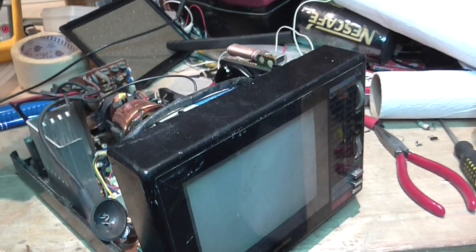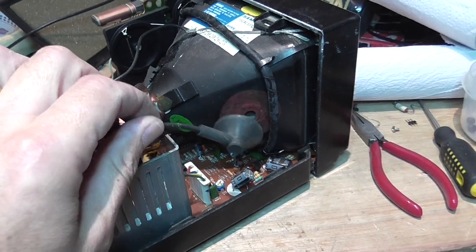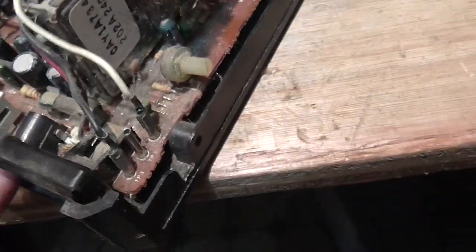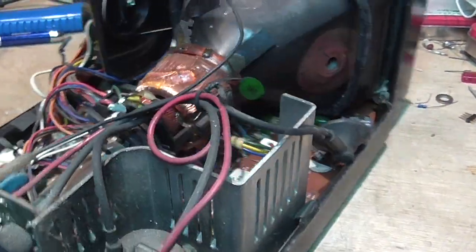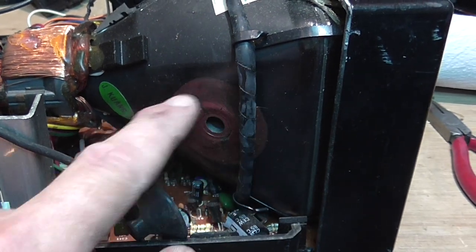The first problem I found — I'll take the cover off here. I already disconnected all the cables and I've been checking the high tension. The first problem is the power connector for the power supply was bent down, maybe because the connector was plugged and somebody stepped on it, and the solder there is broken. I pressed it a little bit and it started working, but there's no picture on the screen and no illumination on the screen. But there is high tension, because in the darkness you could see little sparks flying around.